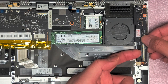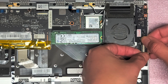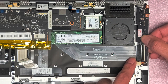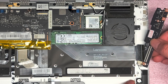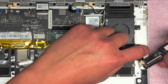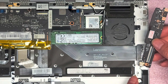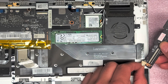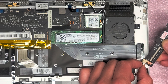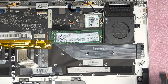Flip this latch — it's for the cable — so get underneath and flip that latch up. Once unlatched, rotate this over to the side to release it. Get the board over to the top so it's easier to access, and now you can access the speaker cable. Just grab that with fingernails or tweezers and wiggle it as you pull — it will come out just like that.